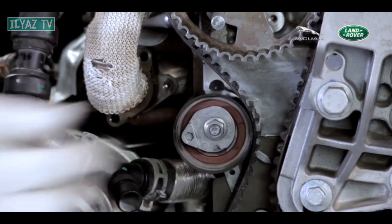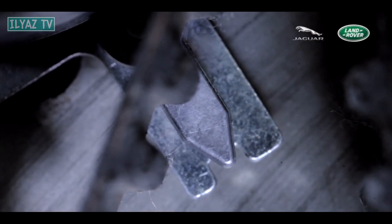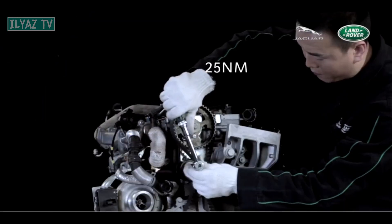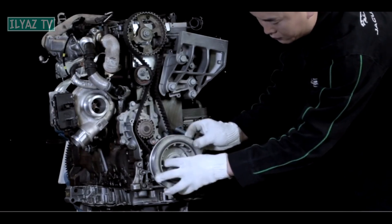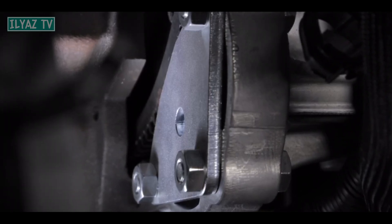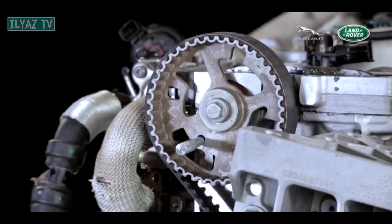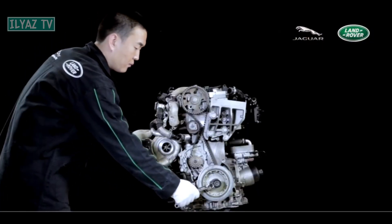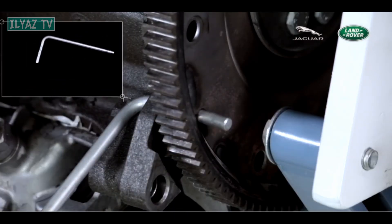The timing belt is already installed and it needs to be turned several times. Carefully tighten the timing belt tensioner bolt manually. Use the tool to adjust the tension force counterclockwise until the arrow is in the desired position, and then tighten the tensioner bolt. The tightening torque of the bolt is 25 Nm. Once installed, turn the engine several times to check and adjust again. Screw on the pulley and remove all special tools. Install the crankshaft positioning tool JLR-303-1270.